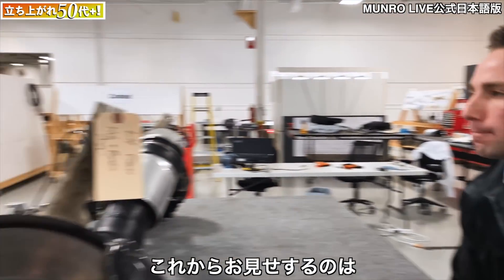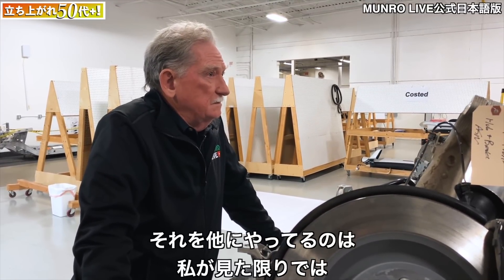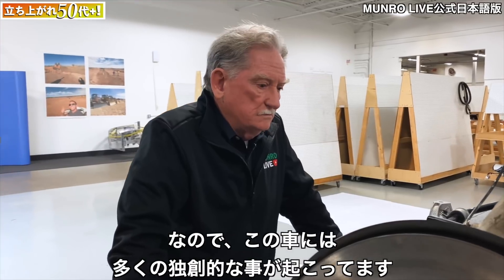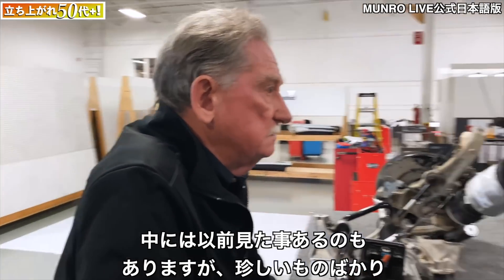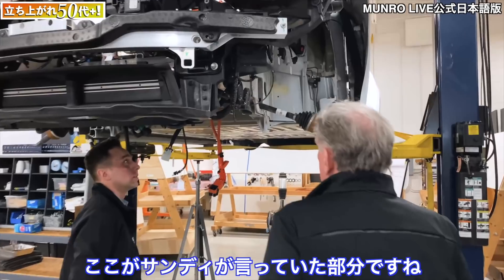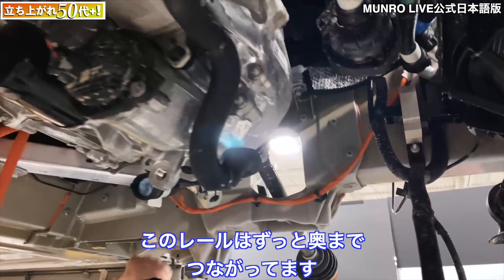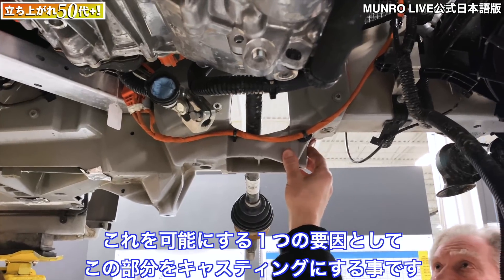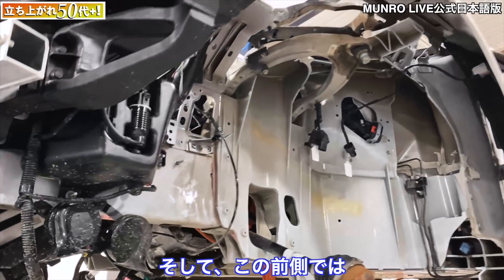One thing we're going to see in a second is where the half shafts are fed through basically part of the body frame — something we've only seen on one other car, the Range Rover. There are a lot of unique things happening here that are very uncommon. Let's pop back here and have a look at the decking done for the motor. As Sandy was mentioning, here are those pockets coming through the rail of the vehicle, and that rail transitions into the torque box area. One of the enablers to doing this is changing this area to a casting.